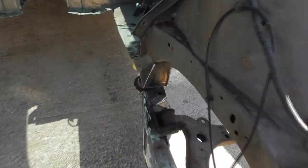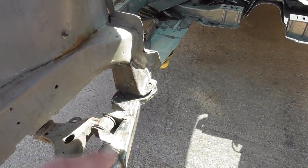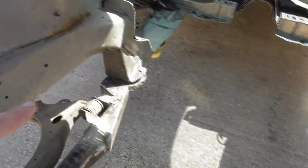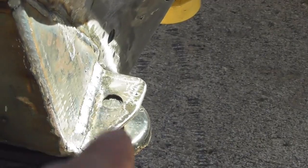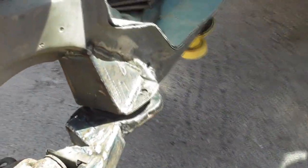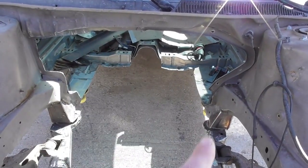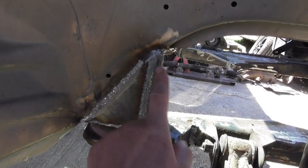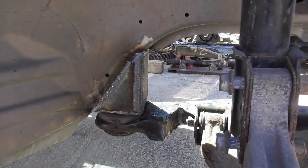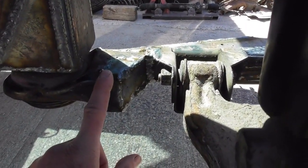Back working on Monty, got a little further on it last night. I showed you this side before — last night we did that side. We did the exact same thing on the passenger side as the driver side. The only difference is you can see that chunk of metal sticking out there — that's the alignment hole for the subframe so if you ever have it out you can get it back in. We moved the mount out so we get more room in there — more tunnel room — making a lot more room for the transmission, the exhaust, and all that stuff. It's all the original stock Grand Prix subframe, all boxed in.